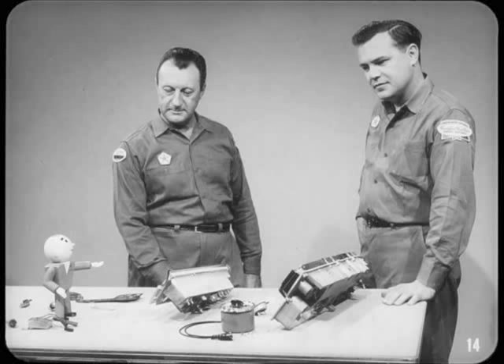The bimetal parts used in other gauge and indicator light units operate the same way, so keep it in mind. Ed has told us that current heats a bimetal arm to move the gauge pointer — now the question is how this current is varied to give an accurate gauge indication.